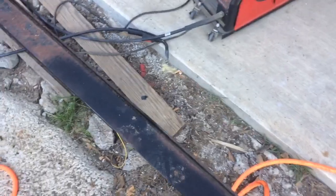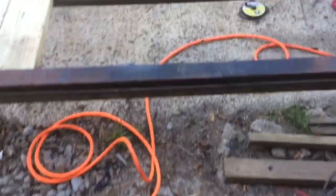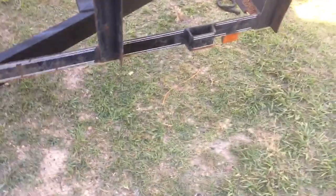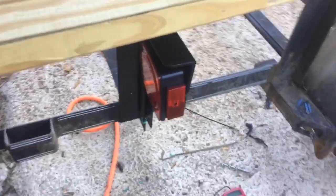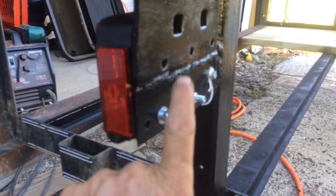This one wire comes back here — this is the three-bulb wire because this trailer is over 80 inches, so we've had to go ahead and order that, and also one of the little clearance lights that mount in the back of the fender. Electrically we're all set to go — there's power at the bad spot, all these lights have been tested, and the opposite side got replaced. The electrical is now done. We had to fabricate a piece and weld it in to allow these taller LED lights to fit.